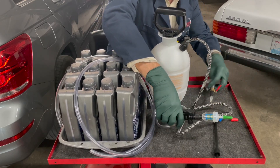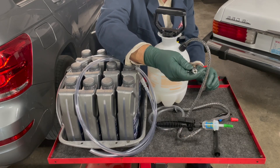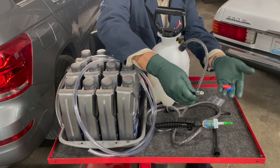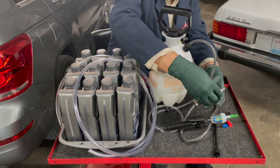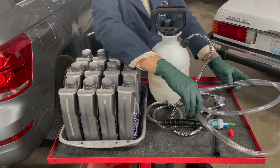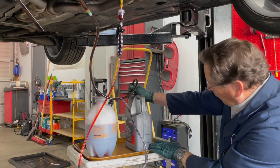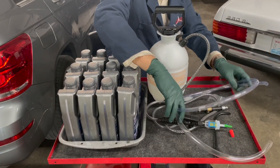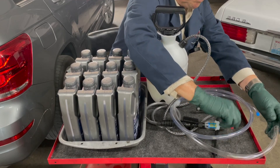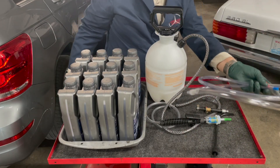I also provide an extra O-ring because after a few applications you'll need to replace the O-ring seal. This fitting is only finger tight into the transmission pan — no wrench needed. I also provide a couple of silicone plugs to minimize spillage when you disconnect this hose, which hooks up to the transmission cooler line so old fluid flows out into a catch can. When you're done, you plug both ends with the silicone plugs — one for the hose end and one for the cooler line side — so nothing drips on the floor.